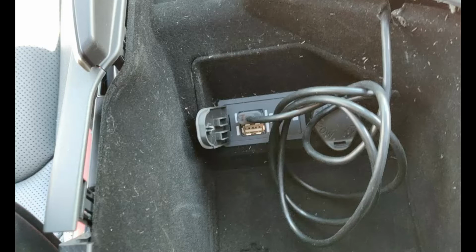The cable itself is run through a notch that was cut in the top of the inside part of the console. The bezel was lifted up so it did not interfere with getting the cable run, and just pops back down and hides the cable very nicely. So the cable could now be run very easily to the front of the dash, as we'll see in a couple minutes.